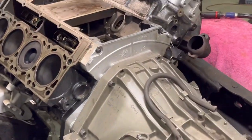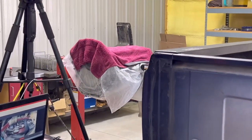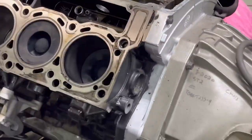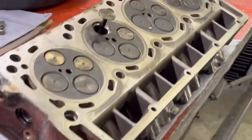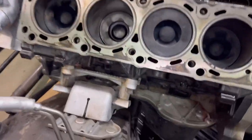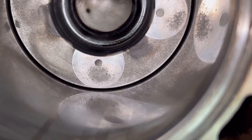That's engine out, engine over there on the stand. So if we break it down to replace the piston, this truck is going to sit until I get the rod hone and until Cody's gets done. Until that engine gets done, this one is available to go on that stand. Right now, or we could button it up. I guarantee that'll seal. Guaranteed. And there ain't no compression loss from that, I doubt. The only thing I'd be worried about is if that mushroomed out the side of the piston.